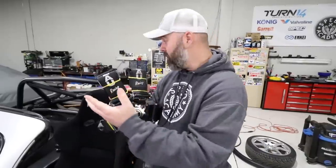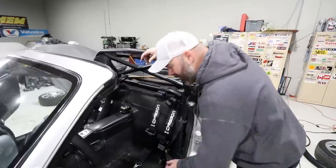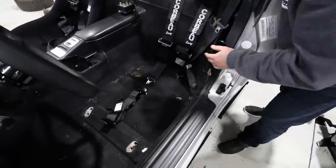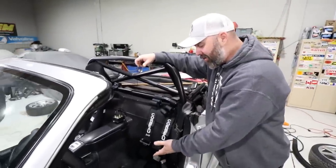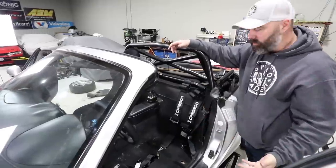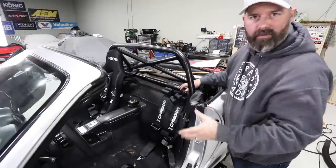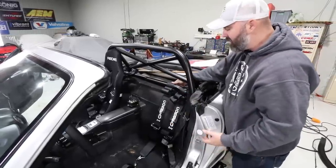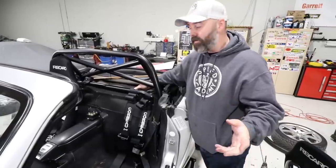The challenge now is to figure out how to install these harnesses. For the lap belts we'll be able to use factory pickup points. The shoulder straps we're just going to wrap to the harness bar which is nicely integrated into our roll bar. It's really going to come down to adding an attachment point for the substrap. Progress has been made — Pete has bolted the substrap to the floor here. It's worth noting that these Corbeau belts came with the bolt-in style brackets rather than the snap-in style. Once it's in it's in, and you don't have the space used up by an i-bolt. I've already installed the shoulder straps based on the lengths we tested on the passenger side. Just wrap them around the harness bar using the correct technique — if you want more information you can go to teamvalvoline.com and search for Speed Academy harness install.